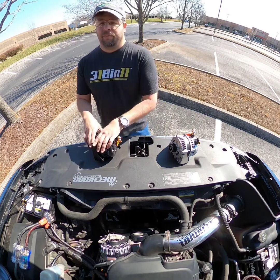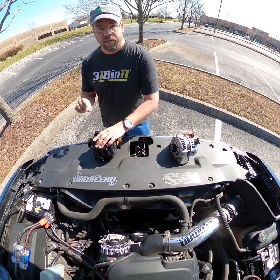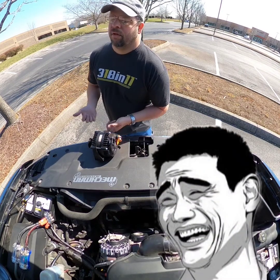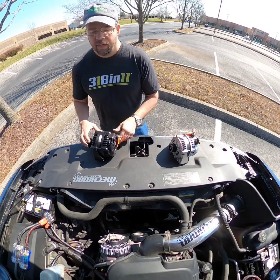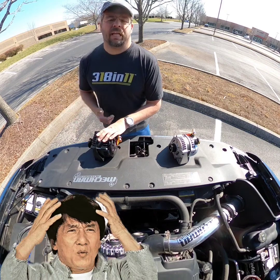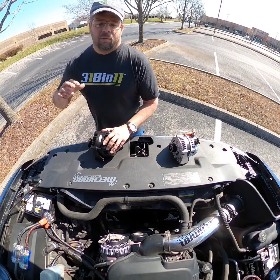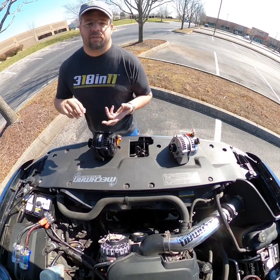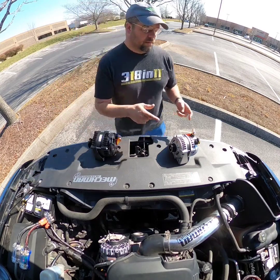Where I would put a large case: any full-size GM truck application with car audio, a plow, work attachments — anything like that. I've got one of these on a Jeep with a Chevy 350, and I wanted this one specifically because of the idle RPMs. When you're winching somebody upside down or with a wheel broke off, you're getting 200 full amps for that winch. That winch will draw 500 plus on initial hit, and you've got to be able to fill those batteries back up — because that winch will absolutely kill a battery in no time.